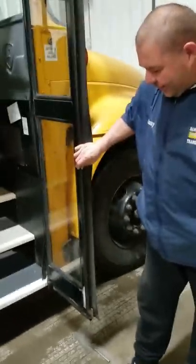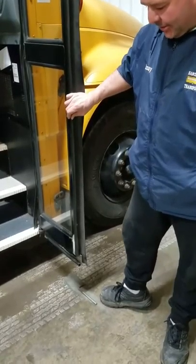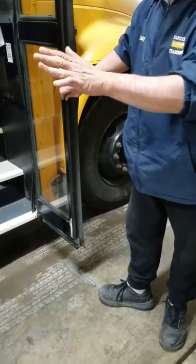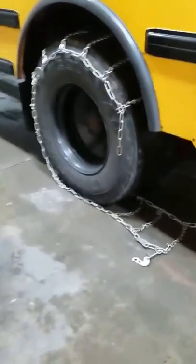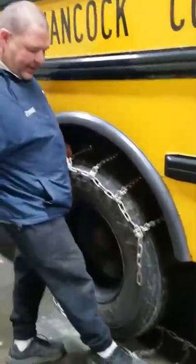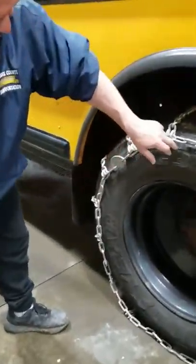We have backed the bus up. Normally, marking the door and backing up that distance is the easiest way to gauge how far to go. That should allow us enough room to work with our chain in the back, get it hooked up, and installed the way it needs to be. Look how nice and neat that chain fell right into place on that tire — it is just about perfect.